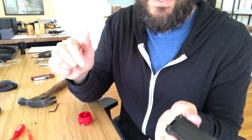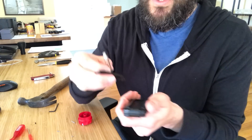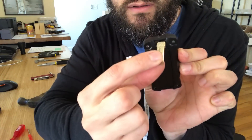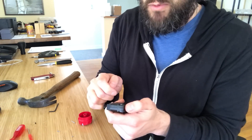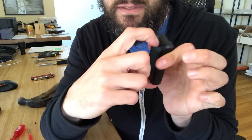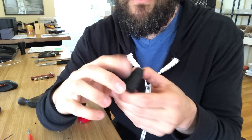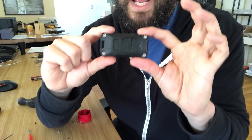Some people ask how you get leverage to use it — this little key is intended only for emergency situations. Depending on how strong your fingers are, you may be able to just grip it directly, or you can use the key ring hole to get a grip. I wouldn't recommend using it as an everyday thing, but for emergencies it'll work fine. Also, if the key is very difficult to remove with your fingernail, work it in and out with a screwdriver a few times to wear off any manufacturing flash. We designed it to be a tight fit so it doesn't accidentally pop open and you don't lose your key.